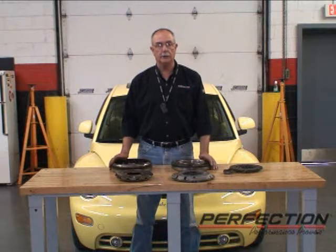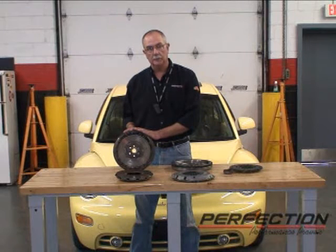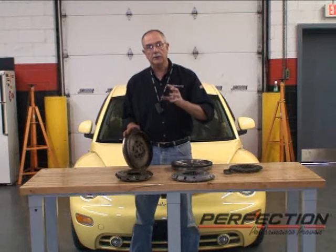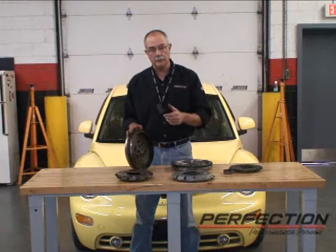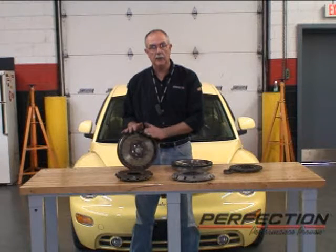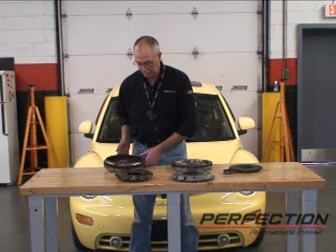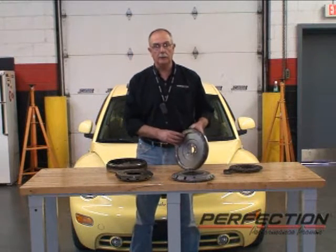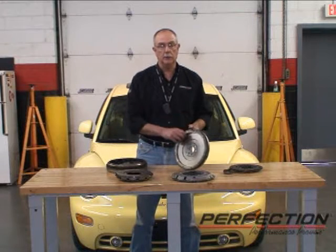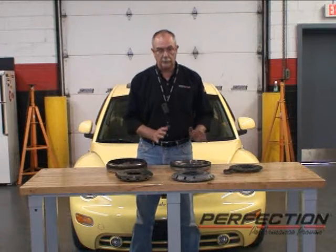The clutch installation is complete on the 2000 Volkswagen turbo diesel. We removed a dual mass flywheel-based system. The dual mass does an excellent job of minimizing gear noise, which comes from the pulses of the crankshaft as they're passed through to the transmission. But it's got a lot of moving parts and it does wear out eventually. We replaced it with a solid flywheel system — one piece of cast iron and a ring gear — and the torsion damper was moved from the dual mass into the clutch disc with a traditional diaphragm style clutch cover. It's a simple, very effective system.